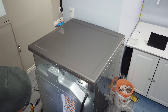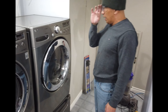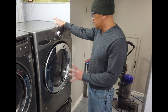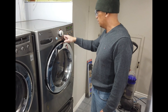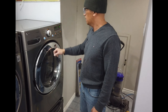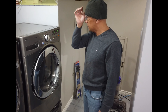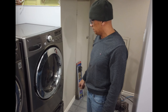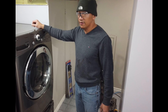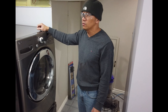So everything is in place. We're now going to plug this back. We have replaced all the drum rollers with new ones. Let's now try how quiet it is. There you go — no more irritating noise on the dryer, it's all smooth now. I hope you learned how to replace the drum rollers on this LG dryer. If you are looking for the same drum rollers with this part number, you can find them on Amazon — click the link below.